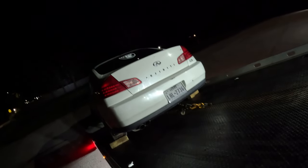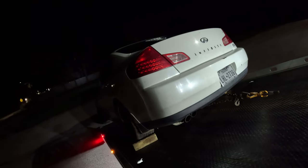Block the tires again. Set it back down. That's a useful trick. I do it a lot, especially for loading dualies, where you've got a big wide truck. You've gotta get it fairly centered, because of the weight of the truck. You don't want a heavy one-ton truck loaded on just one side or the other. You want to have it fairly balanced.